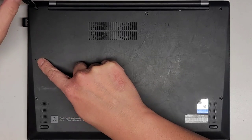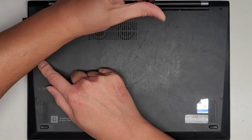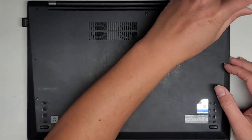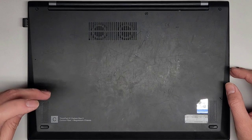If you're wondering, this is a battery disconnect switch. If you use a small screwdriver or a folded-out paper clip, you can push that and it will act like a battery reset. Sometimes if the computer is having issues turning on, that can actually help it. Give that a try if you're having that kind of issue.